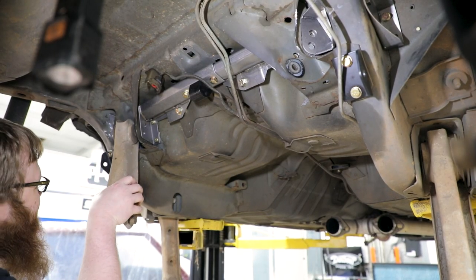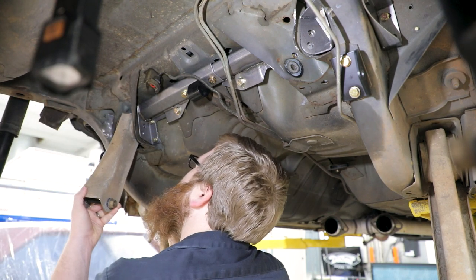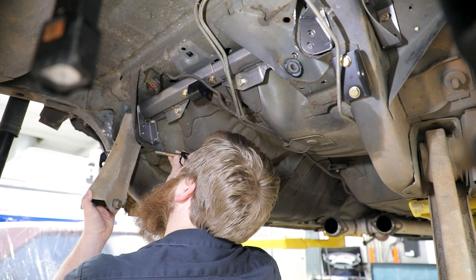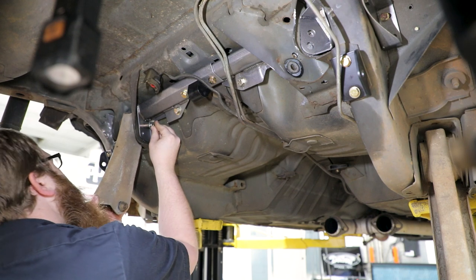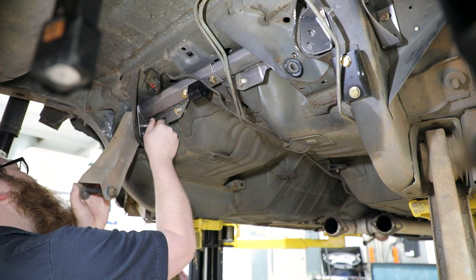Reinstall the exhaust hanger bracket U-nuts back into the upper trailing arm pockets. Reinstall your exhaust hangers and isolators back into the vehicle. Reinstall the upper trailing arms into the vehicle. Tighten the bolts, however do not torque them at this time. Use the two upper link mounting holes in the EXO brace as a tuning option once you have your vehicle back on the ground.